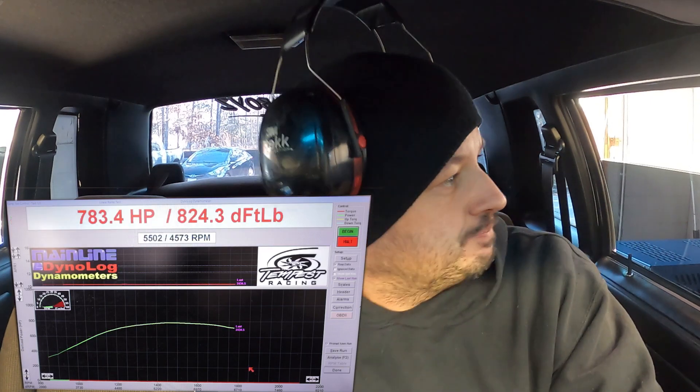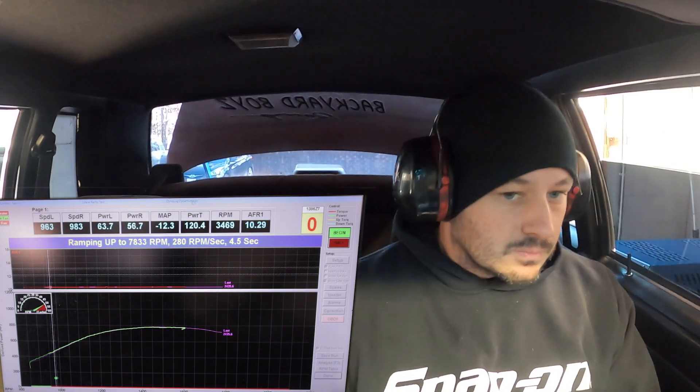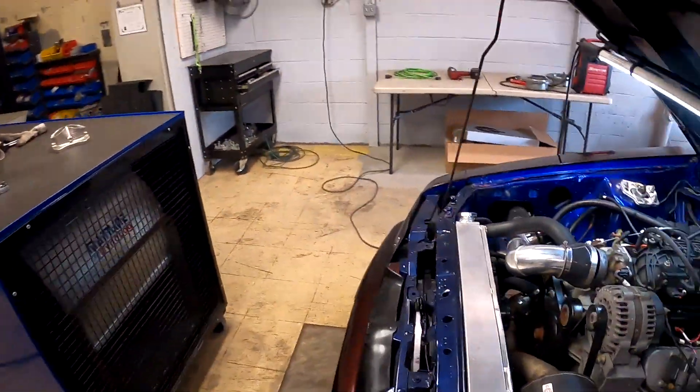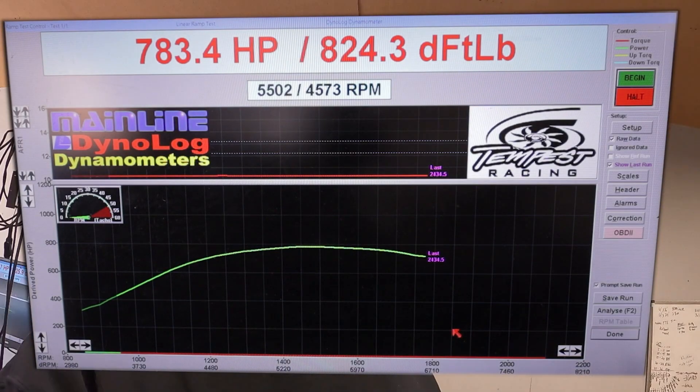I think we're about out of turbo. One more time - I guess we should go buy a lottery ticket. We're definitely about at the limits of what this wants to do and the blue charge pipe blew off, so I'm gonna call it quits here. I was really hoping we could get to 800, but this isn't the car or the customer to really start leaning on it. I'm sure I could find a few more horsepower with some timing and fueling changes, but I just threw some more dome pressure at it and boost didn't go up at all. As always, thanks for watching, and hopefully we'll try to make a video of this thing at the racetrack here soon, both on 93 and on race gas.